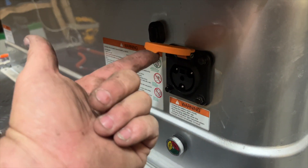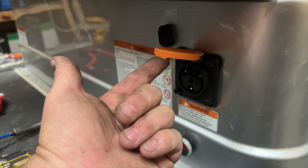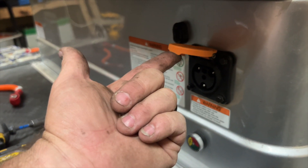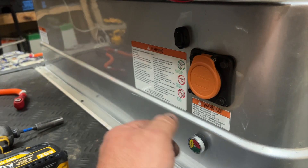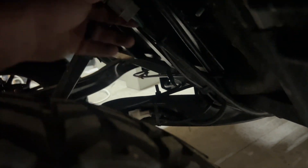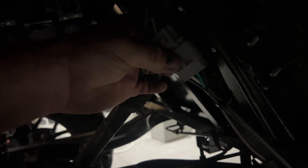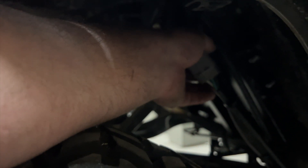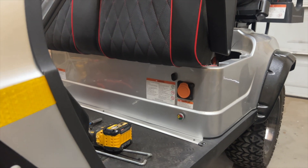Let's talk about the Candy's charging system. This cover is the main 110 volt female port. The Candy has a unique accessory plug that plugs into the wall and into here, so if we could use that, we'll use it. This runs underneath the cart to behind the driver's side front left tire. This connector is your power connector that runs into the charger, and that gray box right there behind the front middle portion of the grill is the charger. But remember, our new charger has a 110 volt plug and the stock one doesn't, so we're going to have to modify this a little bit to keep the stock charging plug and receptacle.